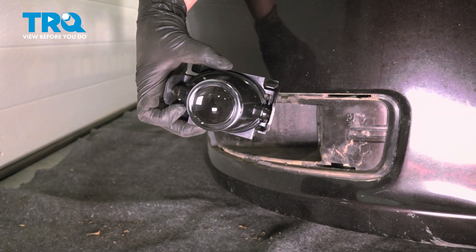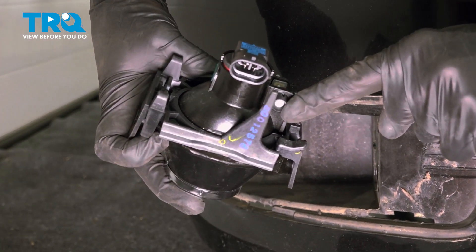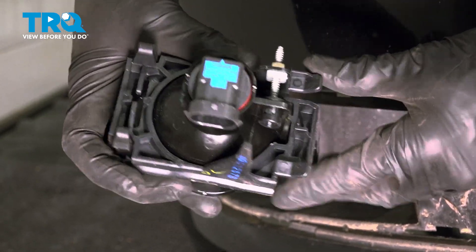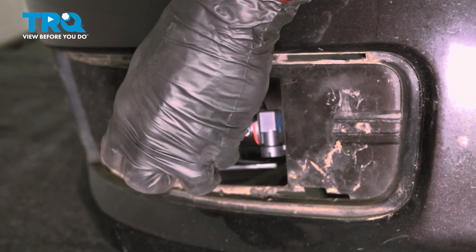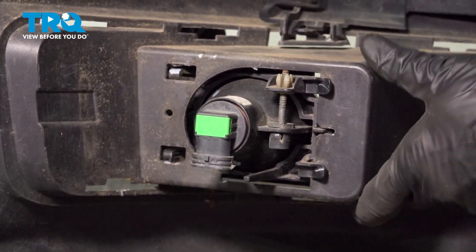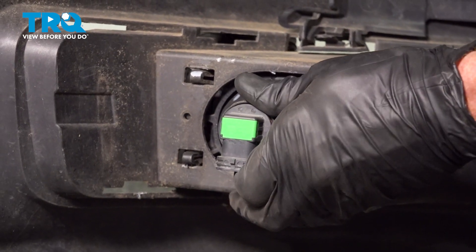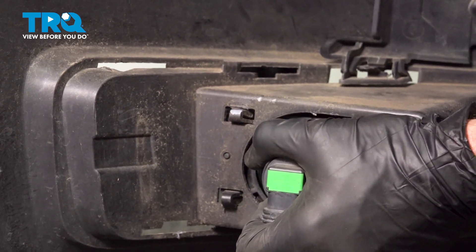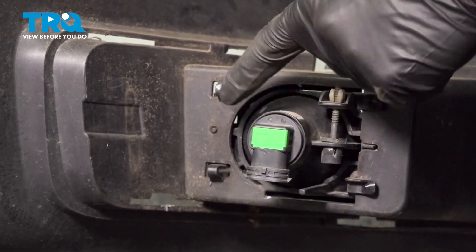Let's get ready to install our fog lamp assembly. Looking along the backside, I want to point out this area — that is where the adjustment would be made. You also have those two areas with the hooks. So when we put this in position in the bumper cover, we're going to come in at an angle, put the hooks along the backside of the bumper cover itself, and then roll it into position. On the inside, we're going to align everything. As for the two locking tabs, have them approximately centered in that rectangular area because there is a small tab that needs to line up with this hole. Once aligned, press it in. With both of those ears locked, give it a wiggle to make sure it's completely secure.